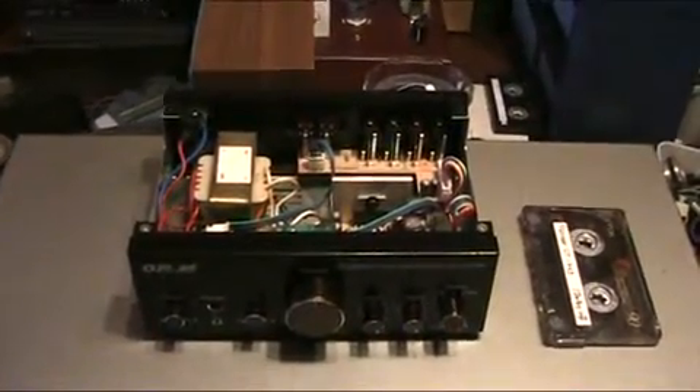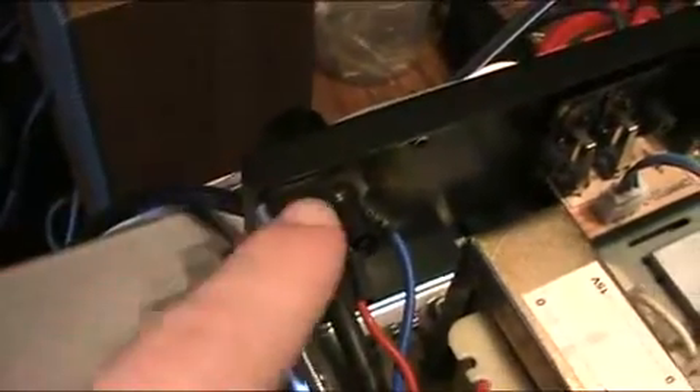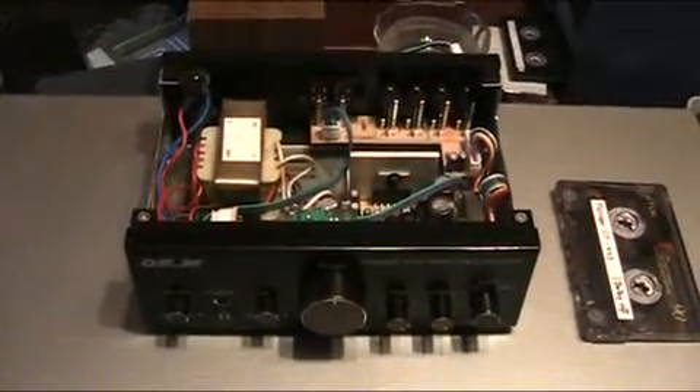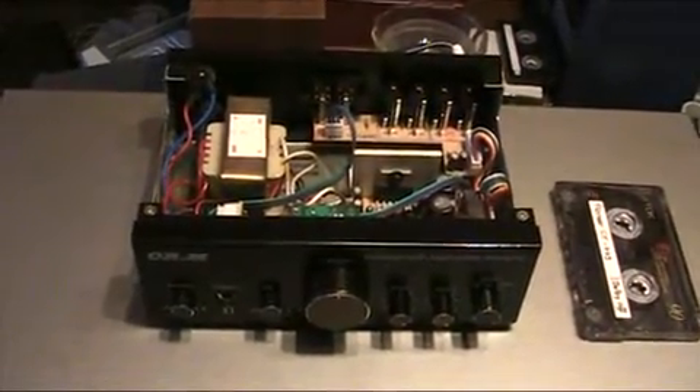The first thing is the power cord. They have used a power cord with a security ground, which is kind of incredible — I've never seen an appliance like this with a security ground hooked up. Also, it actually has a fuse, though the value is pretty much a fantasy value: according to the fuse installed, the amplifier is allowed to draw up to 110 watts before it shuts off, which is about three times as much as this thing should ever draw.